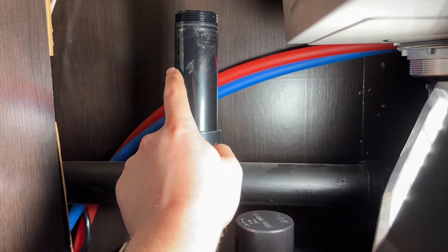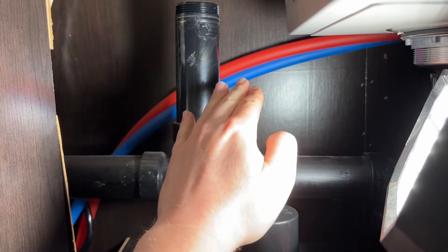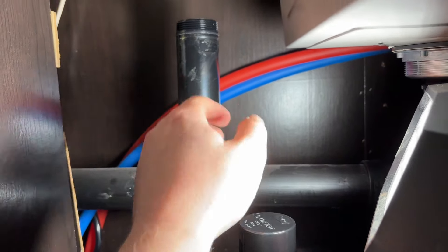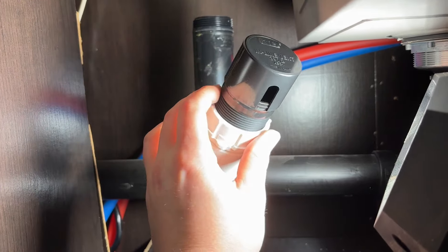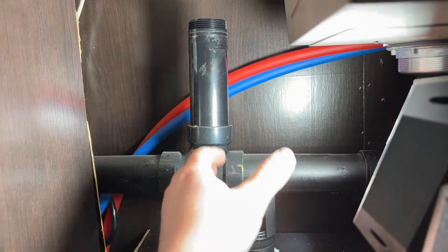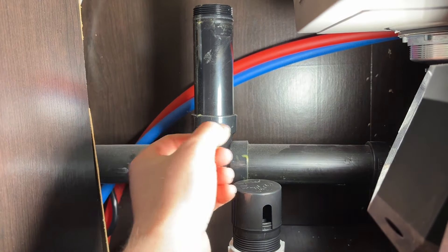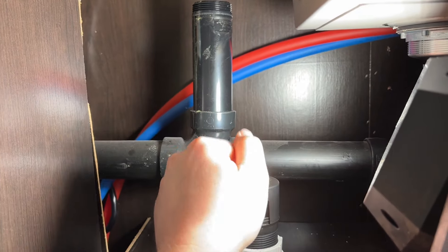So let me cut this off and get this thing removed. That's probably the hardest part — just cutting that piece off. Then you can put in the air admittance valves that are easy to replace with male threads, because once you have those it's super easy to replace them. I'm doing this one before it actually needs to be done, so I'd say do them before you get that smell coming into your RV.